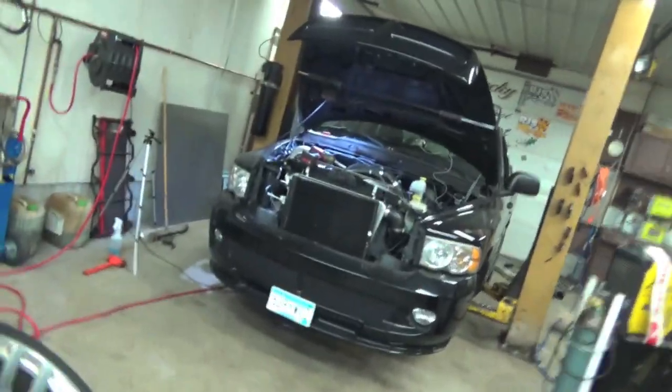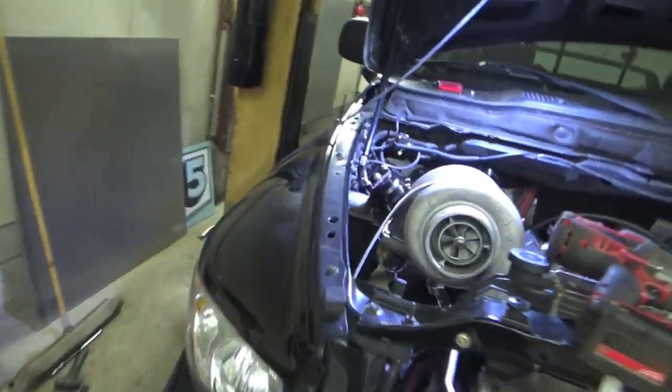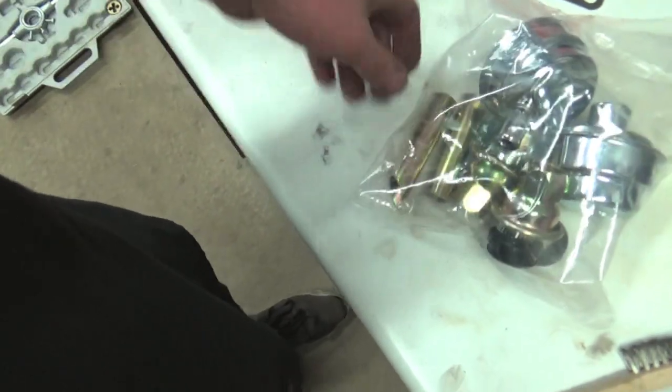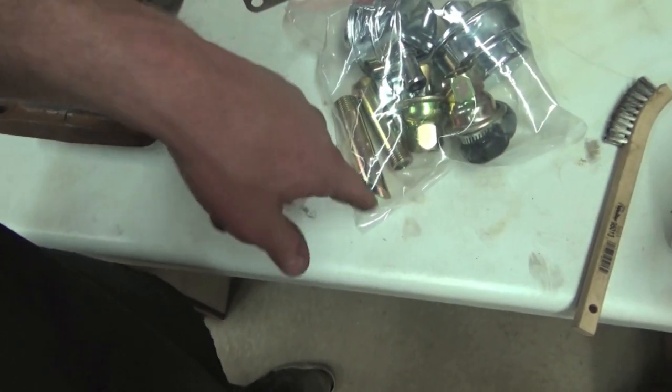Today we are going to be installing an exhaust evacuation system for my 2004 Dodge Ram SRT10 Turbo. If you guys are with the channel you know this baby. We got the new turbo setup and new turbo kit set up. Today we're going to be installing an exhaust evacuation kit which is a new crankcase breather. It uses a venturi effect through your exhaust to pull a vacuum on your crankcase — right here. These little guys got to be mounted at a 45 degree angle, with the exhaust flowing by it, pulling air out and putting a vacuum on the crankcase to help relieve crankcase pressure.